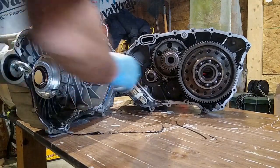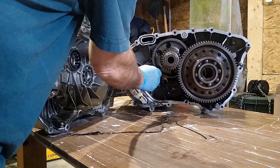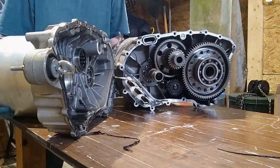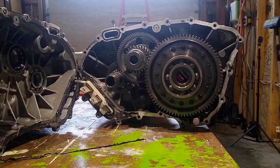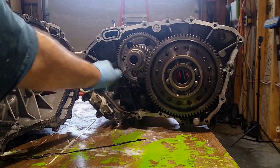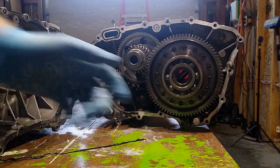As I'm spinning the rotor gear, which is hooked directly to the motor, it then turns the intermediate shaft gear, which then turns the large ring gear on the far right, which is hooked directly to the drive axle. To get the drive axle to turn around once, I have to spin the rotor gear 9.73 times. That's a very aggressive gear ratio.